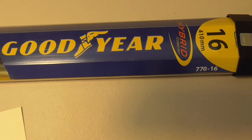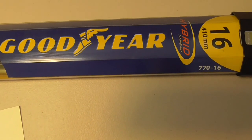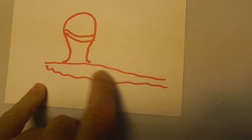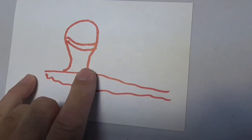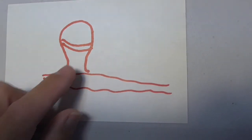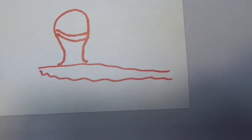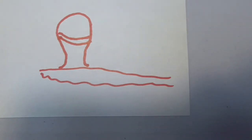I've been using it for years, but now with the new design I spent over 45 minutes trying to figure out how to attach them to my blade post. This is my wiper blade arm, and it's got the pin on there. In the old version you snap the blade out over the pin and then you put a bracket over there that held everything in place. With the new one, it looks like you don't have a bracket to go over to hold it in place — it just snaps in place.